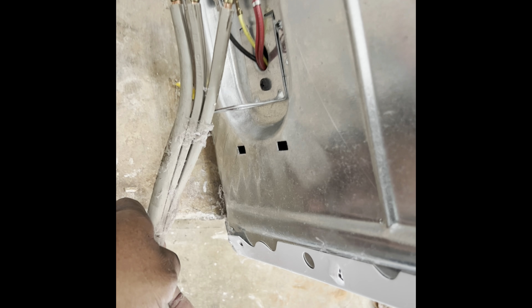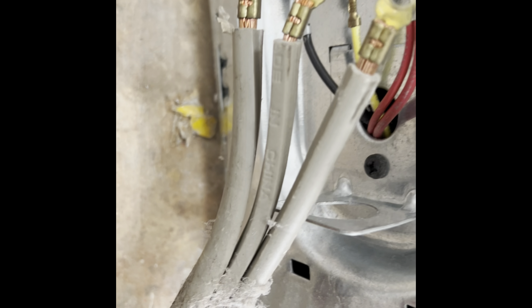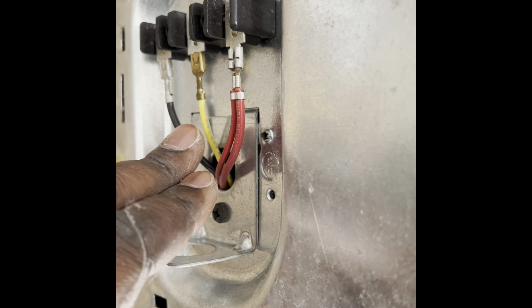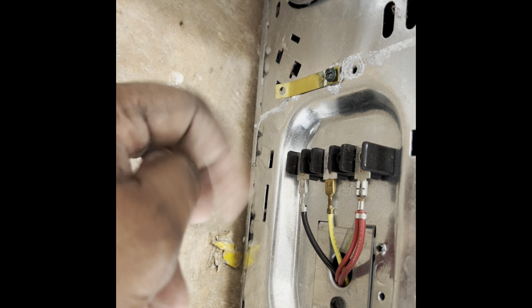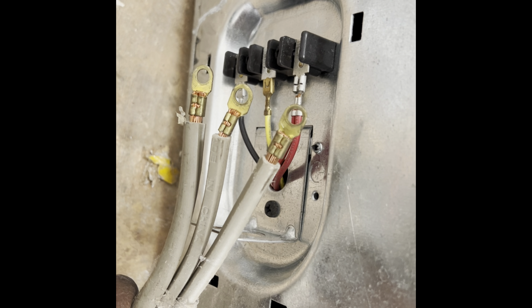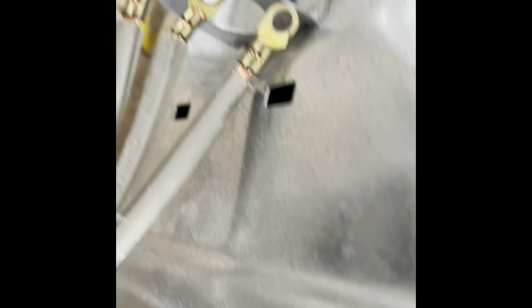So in the three prong, there are three wires and it comes off just like this. With most dryers they have it color-coded — red, this is normally white but they have it yellow, and then black. I removed these three — real simple, you take it, it's plugged up in there with three screws, and there's a hole you pull that out.